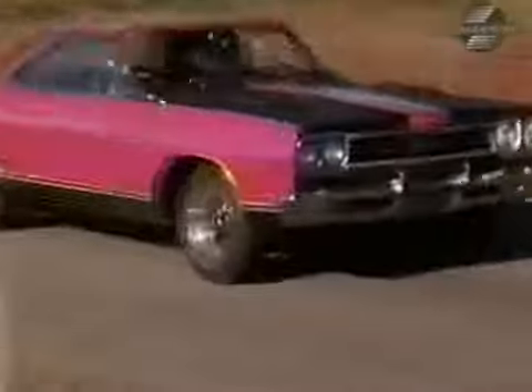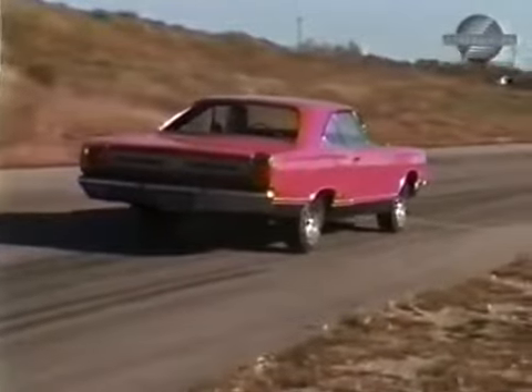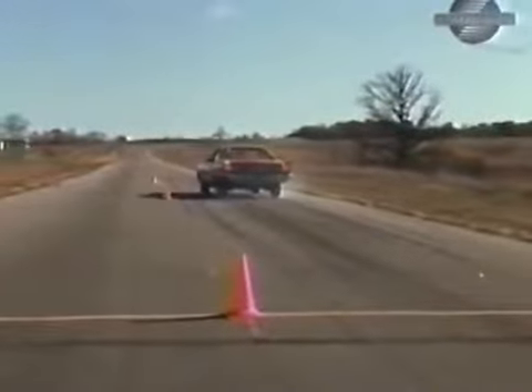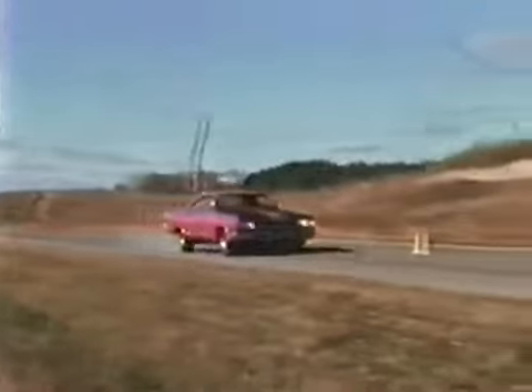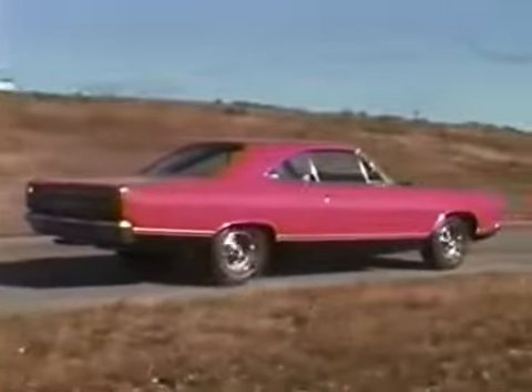In the stop department, this was the best Plymouth we ever had. Braking was far straighter and distances shorter than any of the '68 models. From 30 miles an hour, 34 feet. We had power discs up front with single piston operation. From 45 miles an hour, it took 55 feet to stop. We made several 50-mile-an-hour stops and noticed that brake fade was only slight. The binders were hot when we made this 65-mile-an-hour stop, and she still shut down in 179 feet.